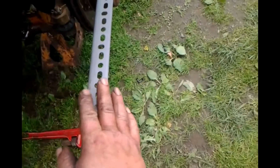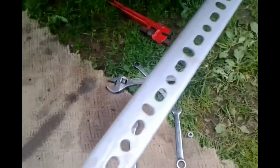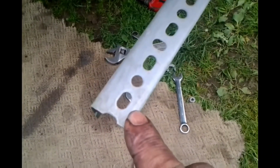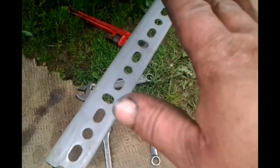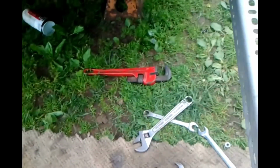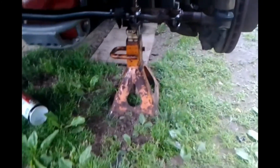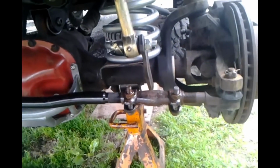All right, well, after 3 or 4 trips up and down, on the inside, the stage center, I have 63 and 11/16, 63 and 5/8, give or take a 16th. Because like I said, these things have a tendency to want to move. You try not to put too much pressure on there, just enough to set the tape on. So, with that, I believe our front end is done being adjusted. I'm going to tighten up our clamp there.